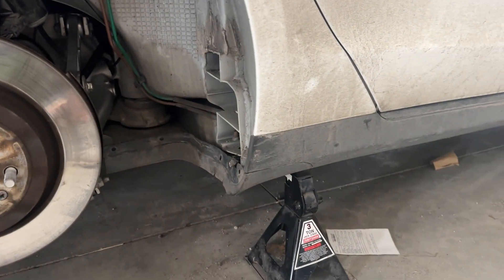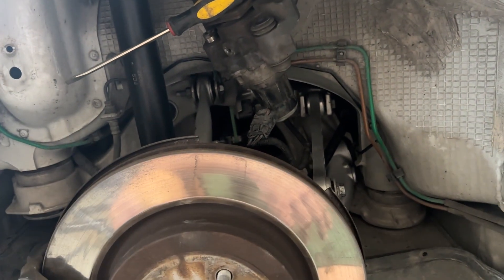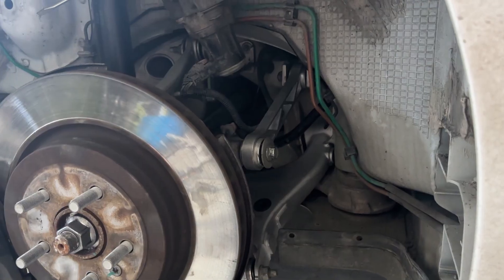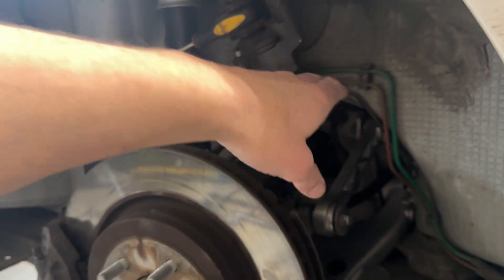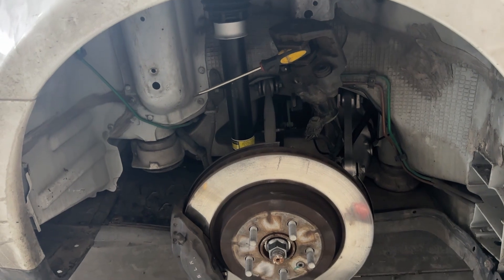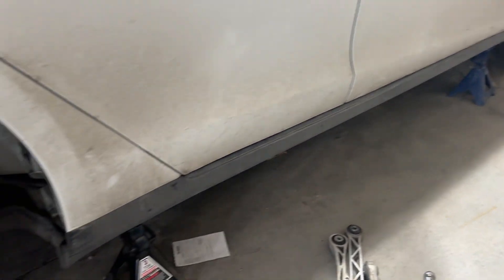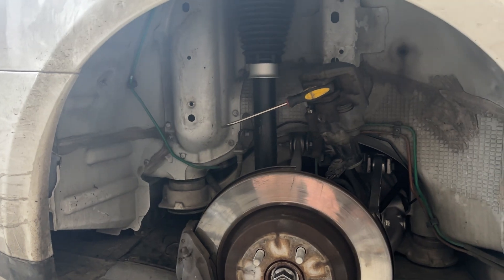One of the biggest things I had to figure out was that before you torque all these bolts down, you have to get the ride height to the standard ride height. Figuring that out was a bit difficult — I did find that you could jack it up to where the measurement, roughly a little over three inches, was correct from one point to another, then torque it down to spec. I did have to drop the subframe, and they also want it on a four-point jack, so I had to borrow some jack stands from my father-in-law. Finally getting stuff tidied up — I do have everything on both sides.